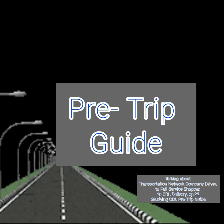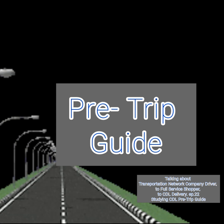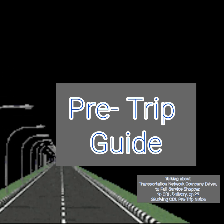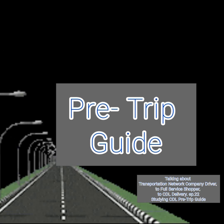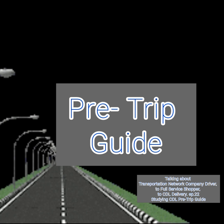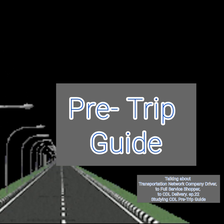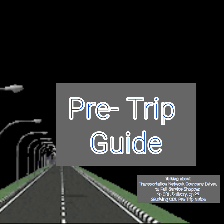Air brake check. I will now perform my brake test. My air pressure is at the proper level of 120 to 140 PSI. Chock the wheels. I will make sure the truck is in neutral. Turn it off. Turn the key back on. Now I will release and push in the truck and trailer brakes. I will wait for the air pressure to stabilize by listening and watching my gauges. Once stabilized, I will begin my brake test. I will fully apply my service brake and hold it for one minute. I should not lose more than 4 PSI in that minute. Will you time me?